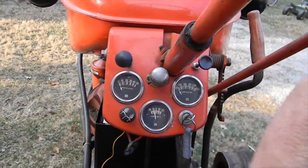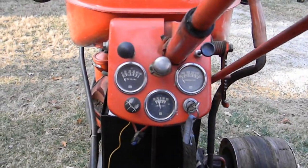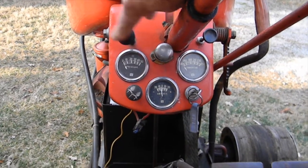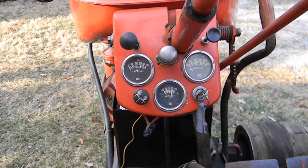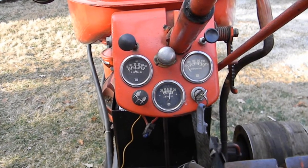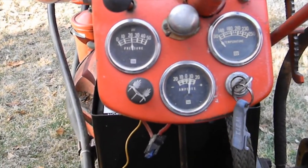Always make sure it's in neutral. I'm just standing on the hitch here. Let's see what happens. Okay, you can see now at this speed the alternator kicks right in — getting a good 10 amps. And it'll quickly charge the battery and drop back down.